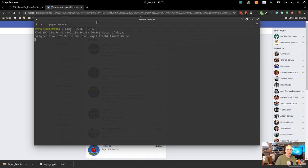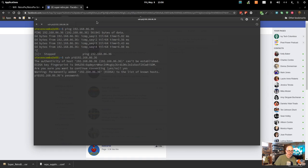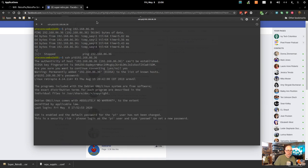192.168.86.36. And if I can ping that, I can. So we are online. That is awesome. So now I should be able to SSH pi at 192.168.86.36. And yes. And then it's going to ask me for a password. Now normally it's the normal Raspberry. Let's check it out. And it is. So we are in.